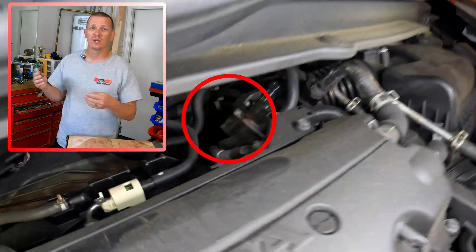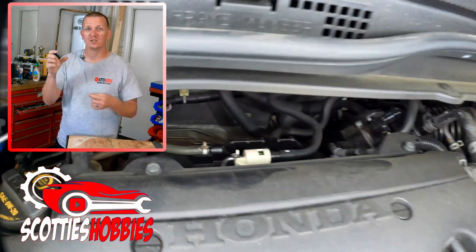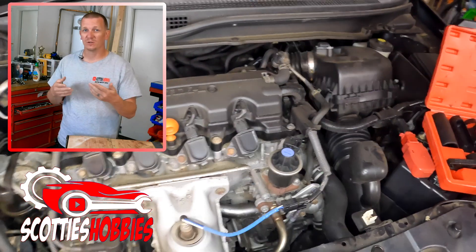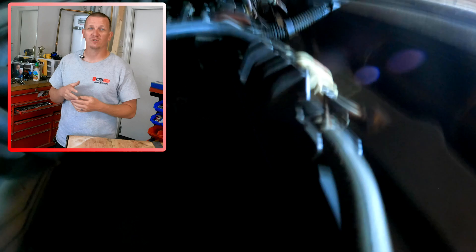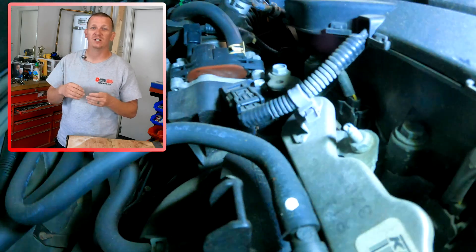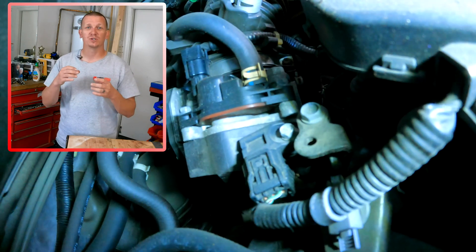The Vapor Purge is located right where the intake enters the engine. This solenoid is actually mounted to the engine. You'll find it on the back of the engine — it looks like two 10-millimeter bolts that hold it on, right on the back side between the engine and the firewall, more so on the driver's side. You'll find it located right where the intake goes into the engine, on the top side of the intake or the throttle body right there — that's where you'll find the Vapor Purge solenoid.